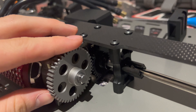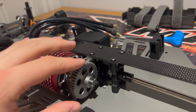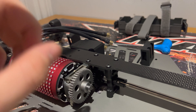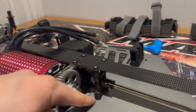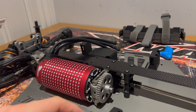The 45-tooth fits absolutely perfectly and is meshing nicely with the spool. This is actually gearing for exactly 170 miles an hour — a little higher than I wanted for starting gearing. I might replace the spool with a 40-tooth, but I can't get one of the screws out from under here, so we'll leave it for now. If we need to gear down, we'll gear down. Next let's have a look at the ESC.